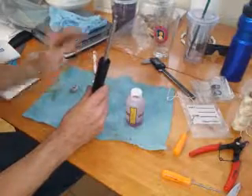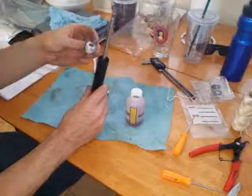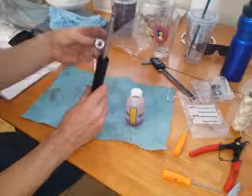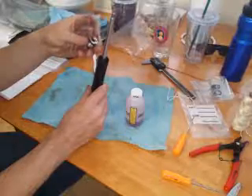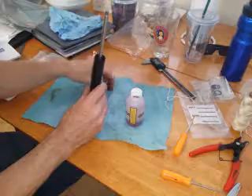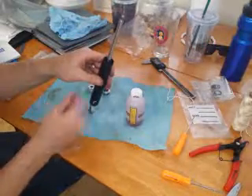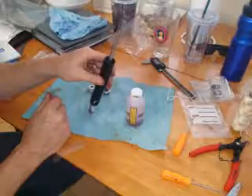You know you have too much oil if you go to put it back together and this piece along with the cap doesn't go all the way down, because you can't have any oil between this piece and the slider piece — it sits on top of that. If you do, you won't get it all the way in. Just dab a little bit of the oil out. I'm going to continue to pump this and get it back together.